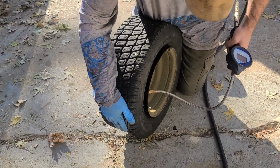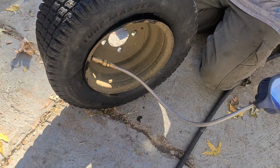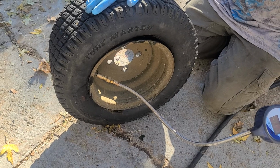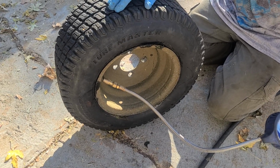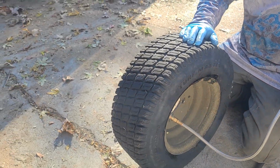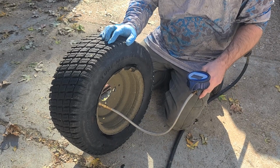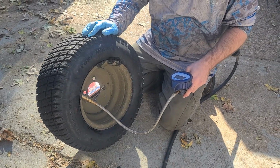All right. Can you come up with your leg right here? Oh, it is, it is. We're getting it. We ain't gotta do the flame. Kinda sucks for y'all though, but you can hear the pop still. So if you get it to air press or you want it at full power, to get it to set the bead, if you don't have like 150 PSI, it has trouble sitting the bead.